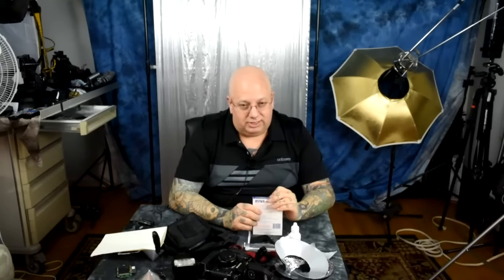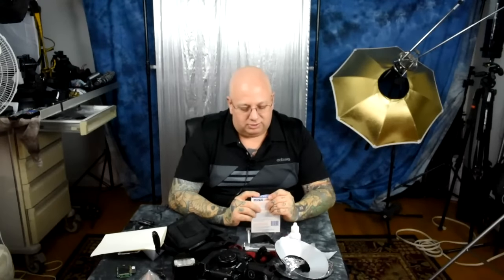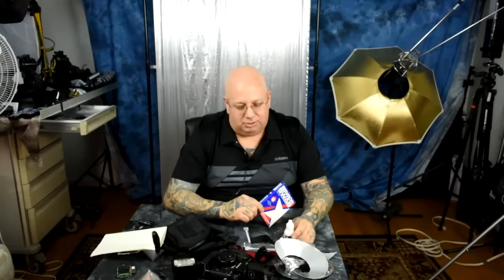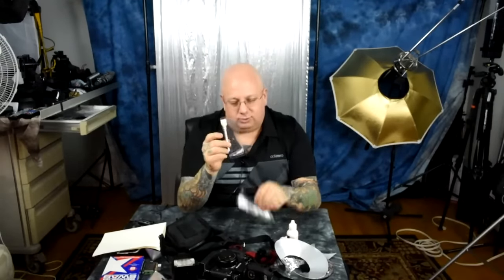When you start doing everything yourself you gain confidence and you stop relying on everyone else. Anyone shooting a DSLR moderately should know how to clean their sensor. Spend 40 bucks and for most people this 12-pack will last three to four years if you shoot moderately and keep your lens caps and body caps clean so crud bunnies don't slip onto your sensor. Go on eBay, buy Photographic Solutions sensor swabs in the right size — either 24mm or 17mm — check their website if unsure. It'll save you money.